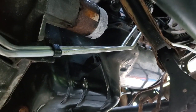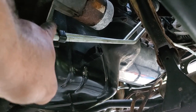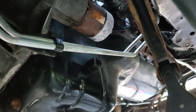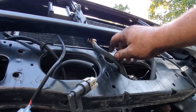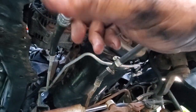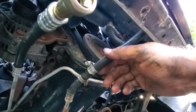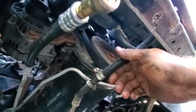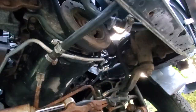These are in - looking good. I'm going down the line replacing old junky ones with new ones as I go, mounting them in the little clips and brackets, heading right up to the front. Here is my return line - this return line is going to come right out into here, which is my trans cooler. It hits the trans cooler before it goes in, so I'm gonna snip off this coupling right in the middle and mate it up. I'll snip and measure as needed - got plenty of room to work with on this nice XJ trans cooler.